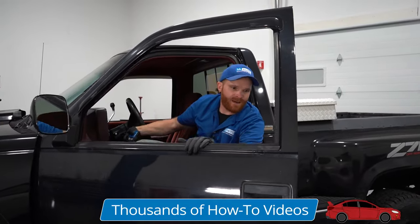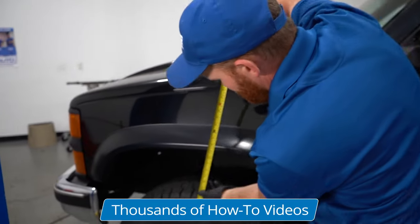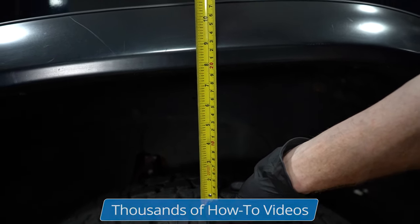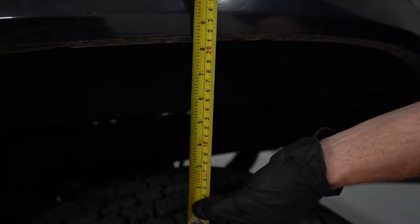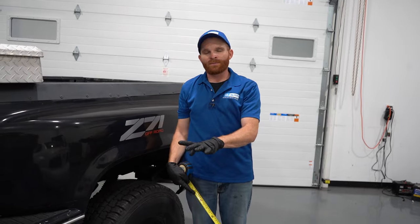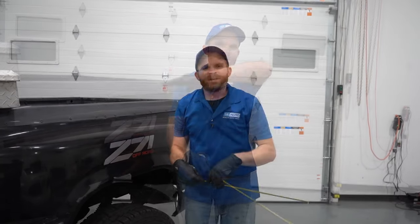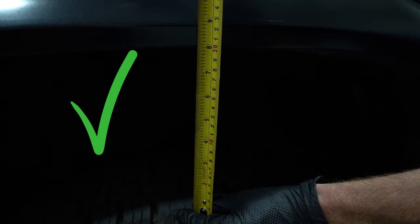Okay, let's measure this one last time. Oh, it feels a little higher. Just below eight — that looks pretty good to me. We'll come over here. So we're definitely a little higher in the rear than we are in the front, which is exactly what we want. One last thing we want to do is check that passenger side. You want to make sure that you're sitting exactly level from the driver's side to the passenger's side. If the passenger side's a little bit higher, you're going to be driving down the road feeling like this. That looks pretty good.